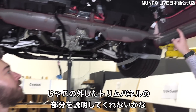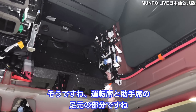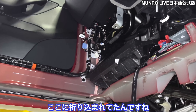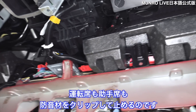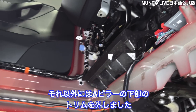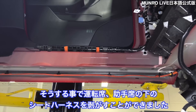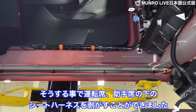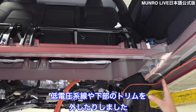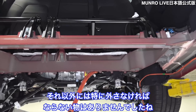There were only a few trim pieces. In the driver and passenger footwell, this is actually where some of the carpet folded up into. On the driver and passenger side, there was just a clip that helped engage with the insulating foam underneath. Outside of that, just a lower A-pillar trim piece needed to be removed so we could peel back some of the driver and passenger side seat harnesses. In the rear, just to get access to the charge port and the low voltage connections, we needed a lower trim piece removed. Outside of that, there wasn't a whole lot that needed to be taken out of the vehicle.